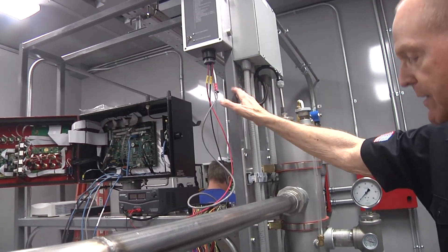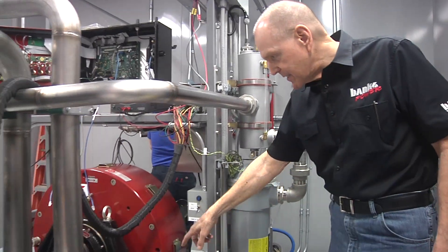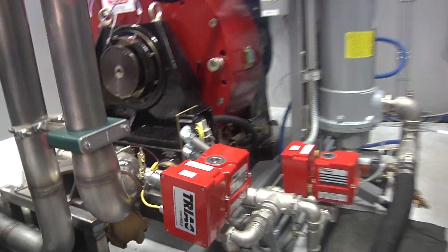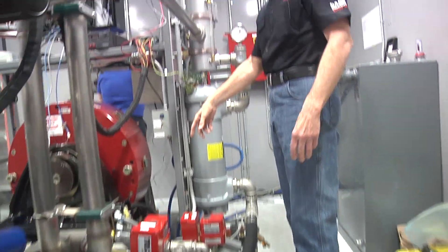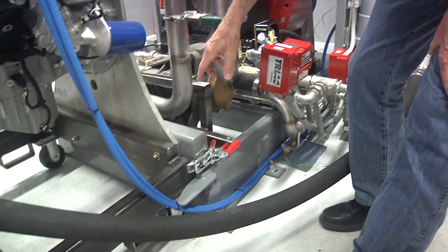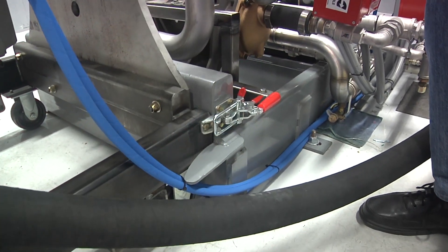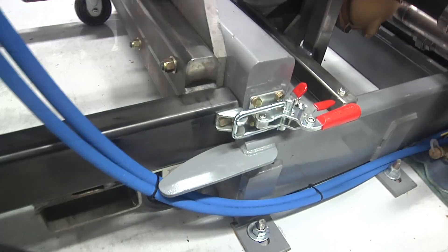This is what we call the trellis. We built the chassis so that there's no twist whatsoever between the engine cart and the dyno chassis. We have large dowel pins that keep everything in perfect alignment, and these little guides slide the cart in as the guy rolls it into the room. This has been going on for quite a while, but this is how we build a hot rod dyno in Southern California. Hope you guys enjoyed this.